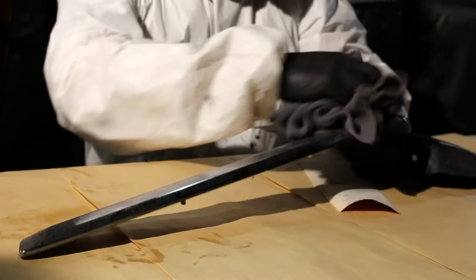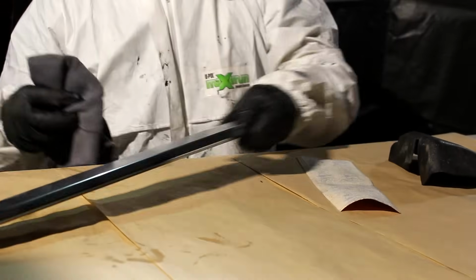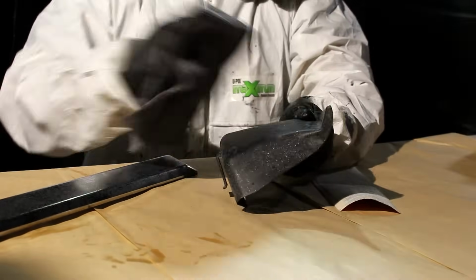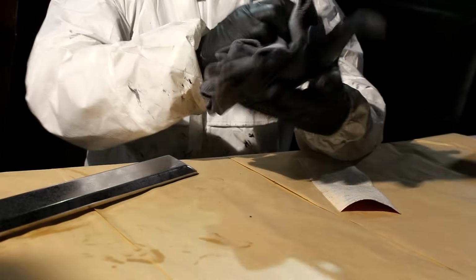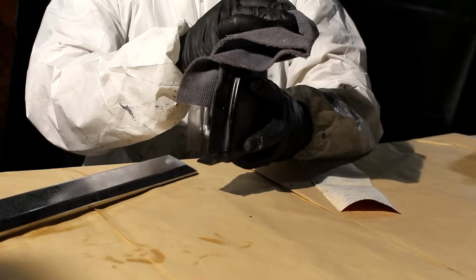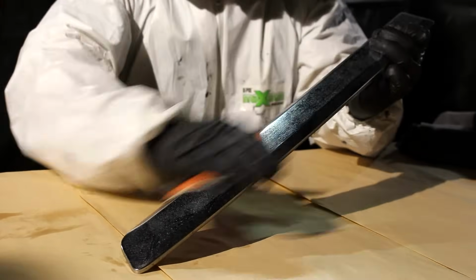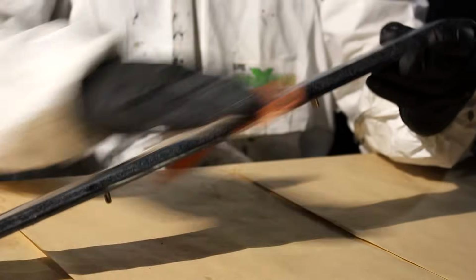For plastic, we're gonna skip the epoxy primer altogether, and we're gonna spray Raptor Liner directly to the prepped plastic. If you take a look at the technical data sheet for Raptor Liner, you'll see that it does separate flexible and rigid plastic when it comes to prep. For the rigid plastic like we have here, we're gonna hit it with 120 to 180 grit sandpaper.